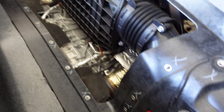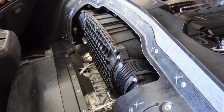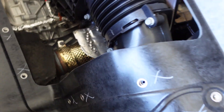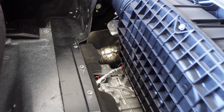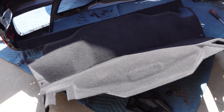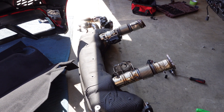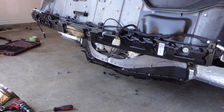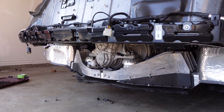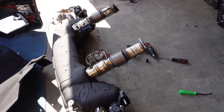To remove the shield there are metal bolts all around it — that's also how you access your cold air intake in case you want to replace it, change the filter, anything like that. You can see the stock exhaust is right there, easily accessible from this side, right underneath that panel. We already made some progress and removed the exhaust. I feel like the Mustang was a more tedious process than this. The only hard part is just removing the back bumper. Difficulty level I'd say like a six out of ten — not that bad. YouTube certified mechanics.